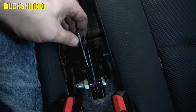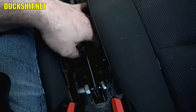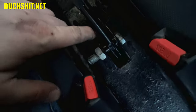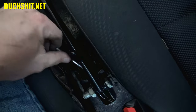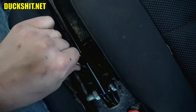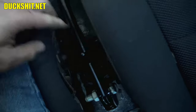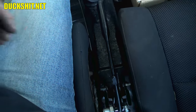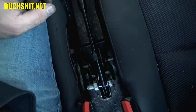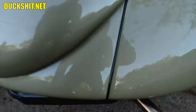and that's great because the little seesaw that goes across this allows me to put the nuts on the end of it, so this cable is now effectively long enough. This was the problem with the other one. You see? Way too short. Wasn't going to work. And it appears that this lever is going to work just fine because the cable is seated in it properly. When I just demonstrated it working, it actually was seated in there properly, so I don't have to replace it with the other one. That's good. Now let's do the same thing to the other side, and then we're going to have some working e-brakes. Another thing that was an issue that's now resolved.